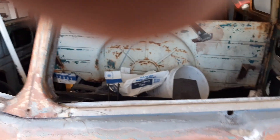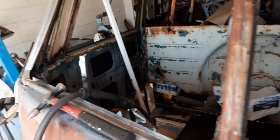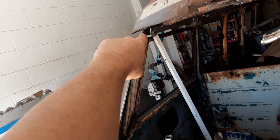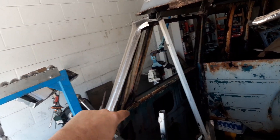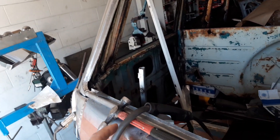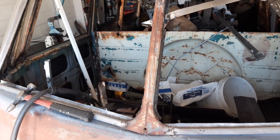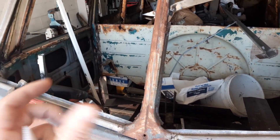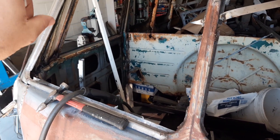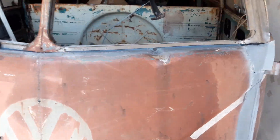Let me take a step back. I went to set up the rear framework that goes up — I thought that would be the best idea — and then I could build everything off of that, but I really didn't have anything to go by. So I thought, we'll take a step back, work on the face of it, then take the whole face out, rebuild the back, clamp it onto the face, put the back up against where it's got to fit on the actual vehicle, then cut it, fit it, weld it.